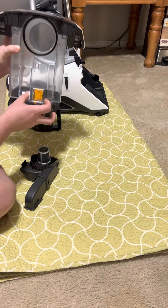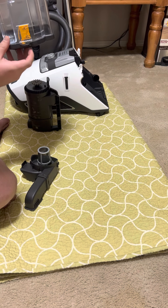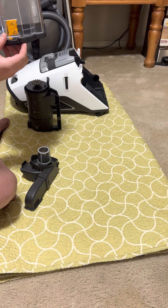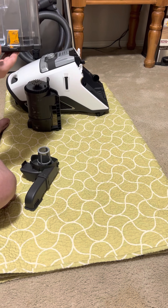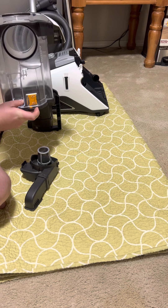A good way to not break the latch is to just gently close it. I mean, it's a thousand-dollar machine — you don't want to slam it. Pull this back, this is the latch, then close it with your other finger and let go of the latch, or use your fingernail to pull it over. You can see the teeth — there are grooves in the latch where it attaches to the component. Make sure it's fully latched, pushed up all the way, and the latch is moved as far to the right as it will go.